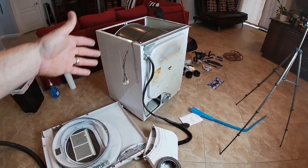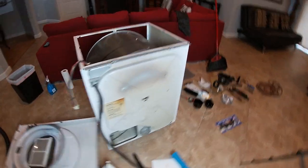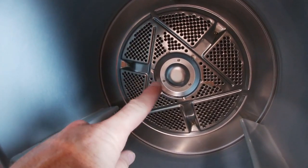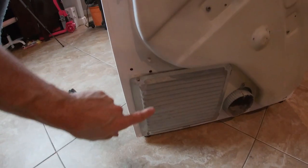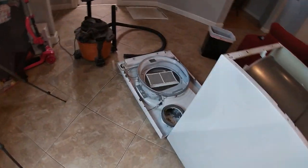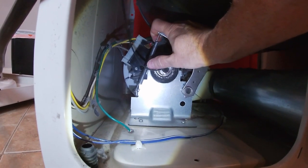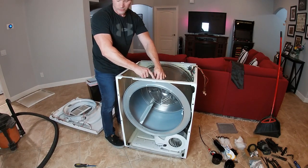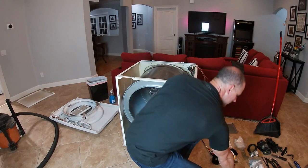After seeing those issues, I had a good idea of what the problem was. Now that this is clean, let's get the drum out of here and keep moving forward. We're actually going to be going for those three screws back there. To do that I'm going to have to pull this drum out - I need to pull this access cover off so I can get to the belt, take the tension off of it, and then pull this drum forward. It's got a tensioner right here - that white piece with the spring. You're going to pull the tensioner up and to the right and then take the belt off of the motor. Now we've got no tension on the belt and we should be able to pull this drum up and forward.